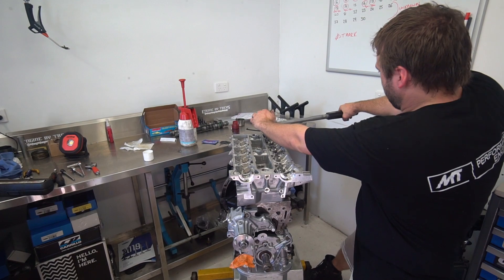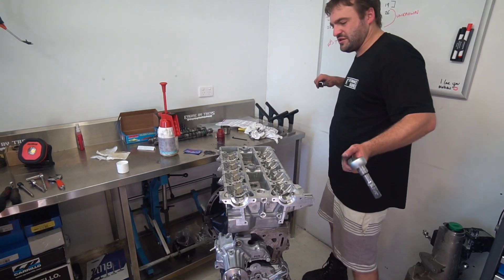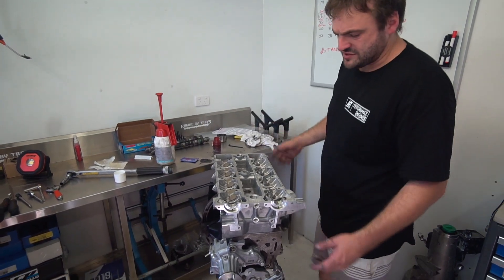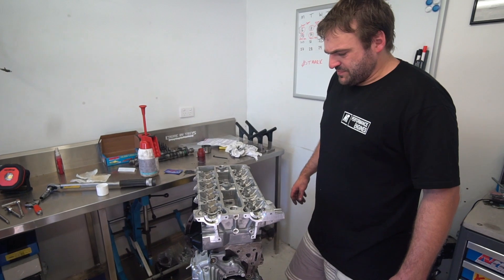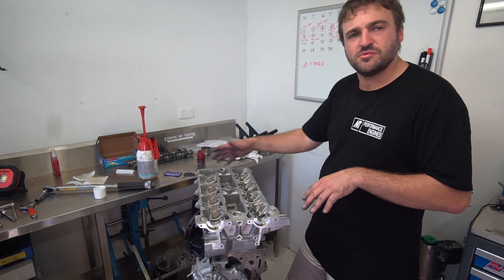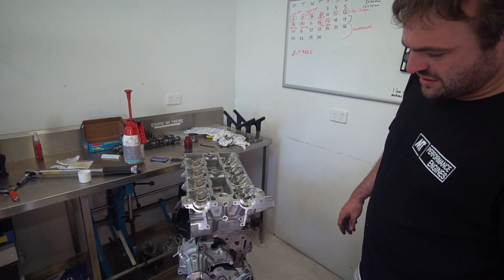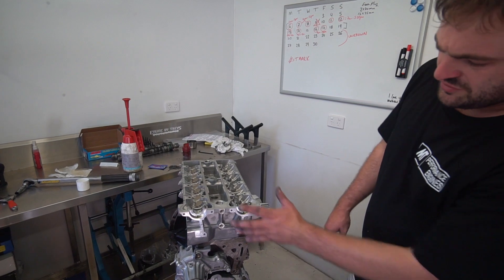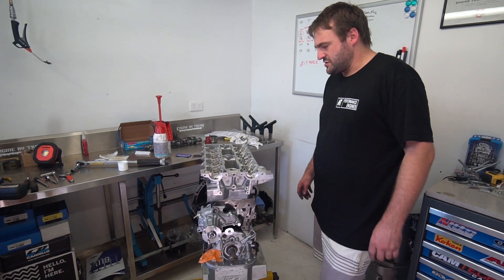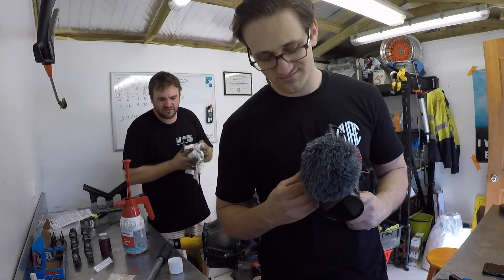You'll see me put myself in a funny position just to get it right, with nothing impeding me. If my elbow hits something and I have to stop, going again means it's going to be at 55, not 60 — because the specification of 60 foot-pounds is done when the bolt actually stretches to 60 pounds, not when friction binds up. Now that it's tensioned down, we'll let this sit for 20 minutes, come back, double check them, and run 60 foot-pounds over them again. It should just click — if one moves, we know we've got an issue. Then we'll go through cams, timing, front cover plates, pulleys, belts, time it all up, cycle it over — she should make some compression.